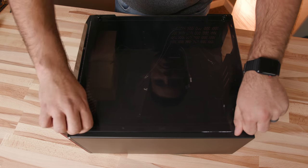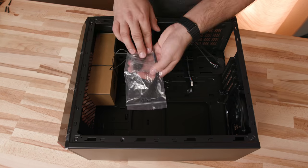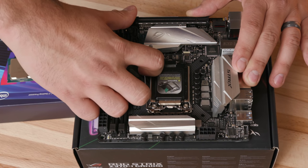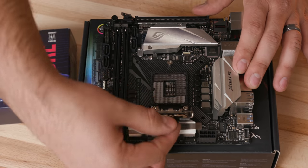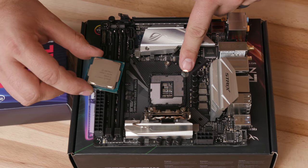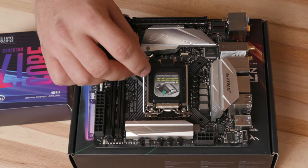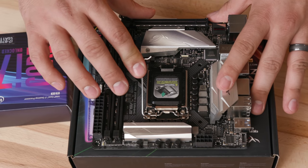Starting off our build, we're going to take off our side panel and set it aside. Next, we're going to take out the hardware and all the zip ties and cable ties. I'm going to start off by installing my CPU. You don't have to do this right away, but I prefer to. You just have to be careful not to touch the top of it so you don't get any oils on the CPU itself. Grip it by the sides — there's a little triangle in the corner that you need to match up with the CPU socket. Drop it in; don't push it. As soon as you close the cover, that plastic cover is going to pop off.